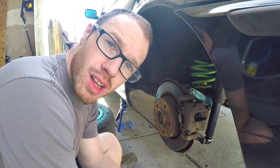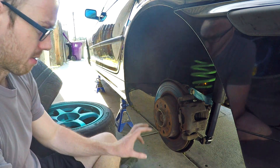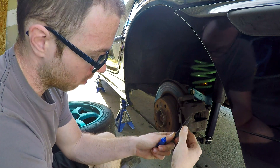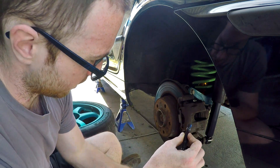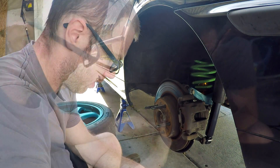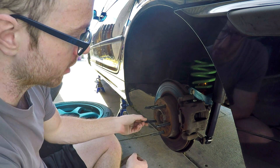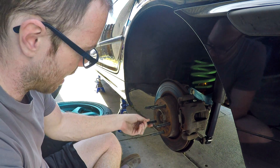Here is our hub — you can see the threads right here. We're going to take one of our Motorsport Hardware studs, put some Loctite on the inside, and screw it in. I asked at the shop what thread locker to use. I thought I'd have to use red because there's a lot of load and vibration on the hubs, but they said blue thread locker is fine — they actually recommended Permatex thread lock blue, which is coincidentally what I already had in the garage.